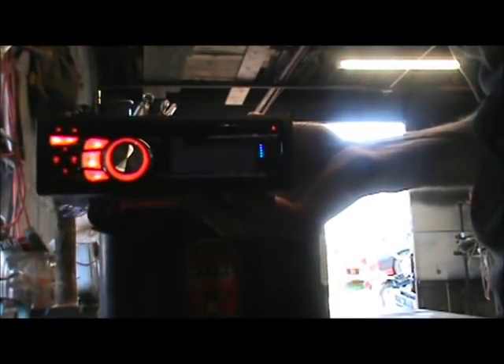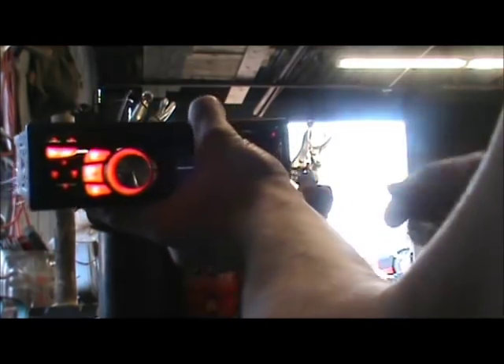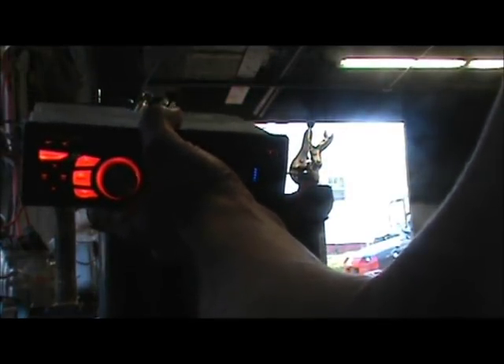For simplicity, let's demonstrate with a straight-up Optima battery. Watch this — I'm going to take some pliers and clip positive and negative to the battery. Now I can plug this thing in and it'll work, no problems. That simple. Look at that — she's on. CD player's on, she works. Everything comes up; it's in demo mode right now. If I put a CD in and had some speakers wired up, we could listen to it right now. Nothing magic — just those three wires.